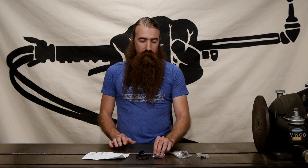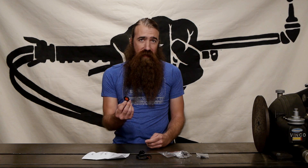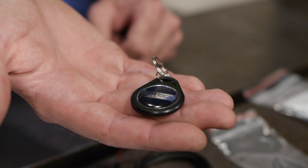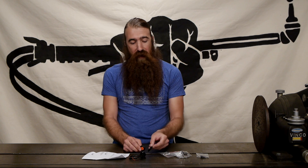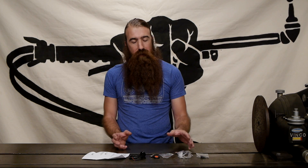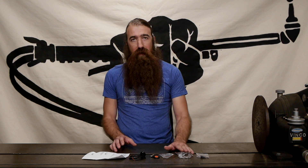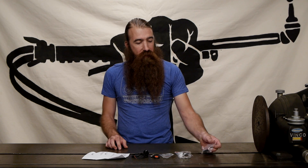There are two fobs and one of them has a red dot — this is the programming key fob, known as the master key. It is unique to each individual reader. You don't want to lose this; if you lose the red key there's nothing we can do and you have to replace the reader as well. The other one with the M-Lock logo, all black, is the actual key fob you use to start the bike after programming. The relay is used on applications that don't have an M unit installed. It provides enough power to control the relay but not enough to actually run the bike. The fuse and fuse holder are necessary because the wiring and circuitry are fairly sensitive and need to be fused at one amp.